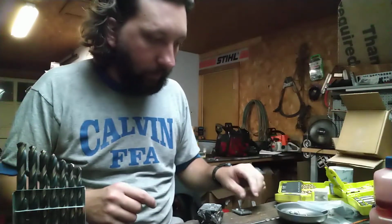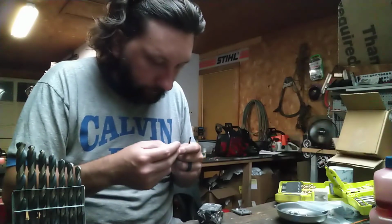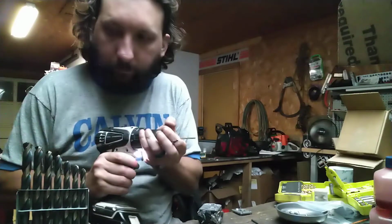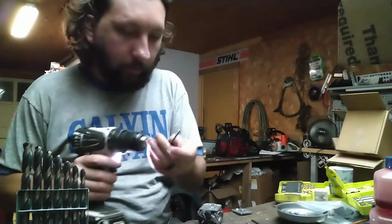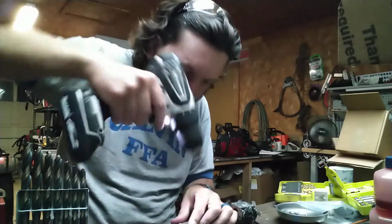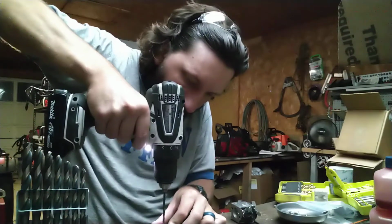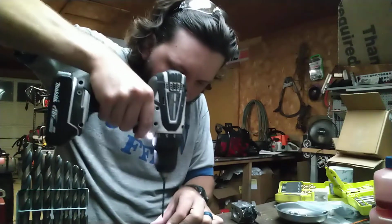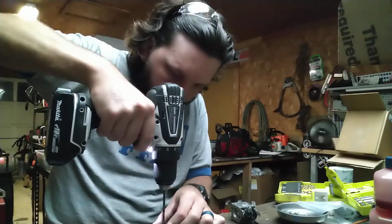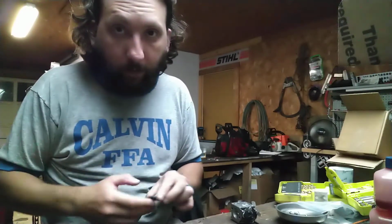See, a lot of these videos, sometimes they're not super planned out. So it looks like I am going to have to use 5/32. Okay, yeah, that's going to be plenty. Just be real careful when you go through to make sure you don't wallow that hole out any bigger than it needs to be.